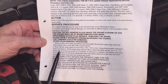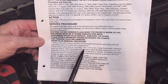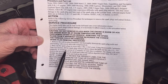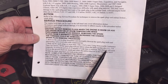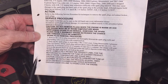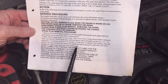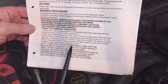The overall procedure says: remove the coil-on-plug assemblies, then spray the area with compressed air to blow out the bore. Back out the spark plugs no more than an eighth to a quarter of a turn, then use Motorcraft carburetor tune-up cleaner. Fill the spark plug well just above where the hex nut sits — about a half to three-quarters of a teaspoon of carburetor cleaner. A minimum 15-minute soak time is required. The cleaner will wick down to the ground electrode shield and soften the carbon deposits. Do not work the spark plug back and forth at this point.